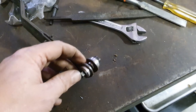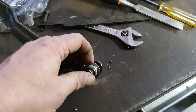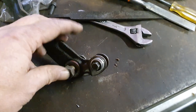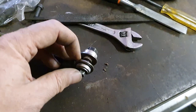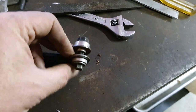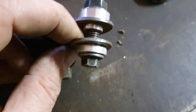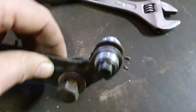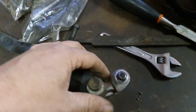My first test run was not too good. I had to really adjust the brake up close to get enough leverage, and it wouldn't release properly. So I got some overheated brakes — there was smoke. I quickly fixed that up, stopped, released it, and drove back. I realized at the front I hadn't spaced out this piece — the hole's far too big to match the cable hole. So I've made two little aluminium spacers. I really should have a shoulder bolt in there with a good flat surface to grip onto. I also need to find a spring — it's supposed to have a spring — but let's try it again.